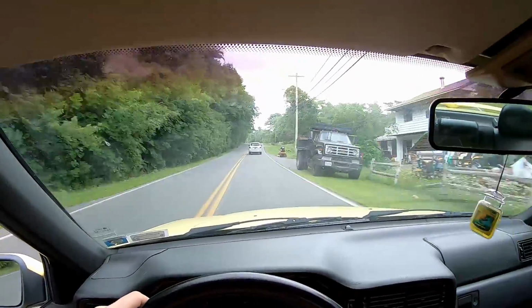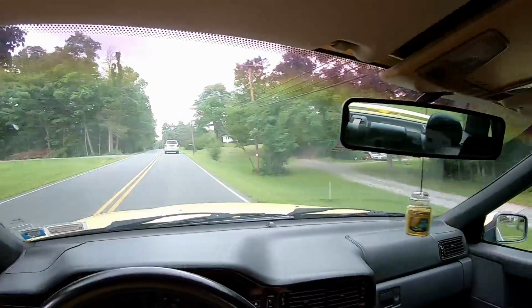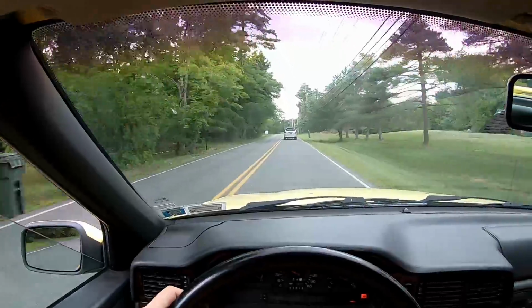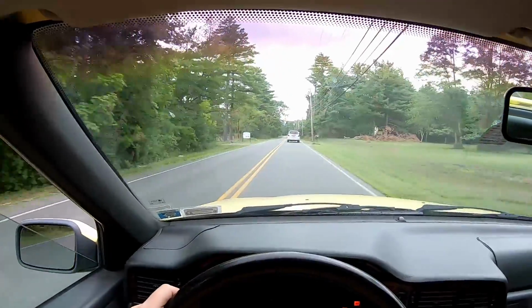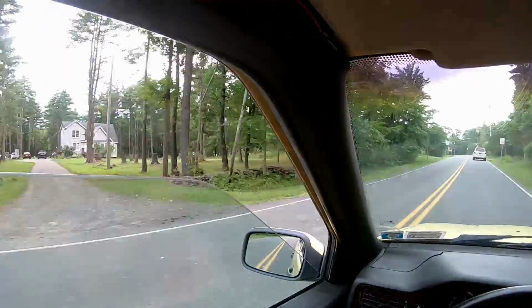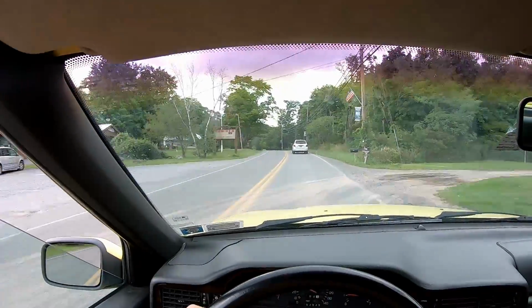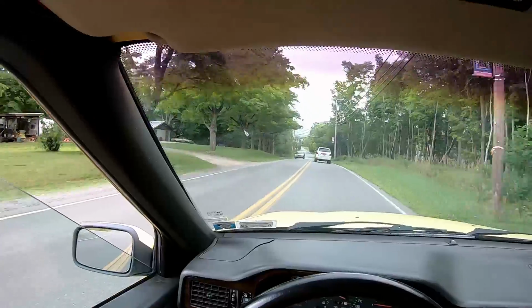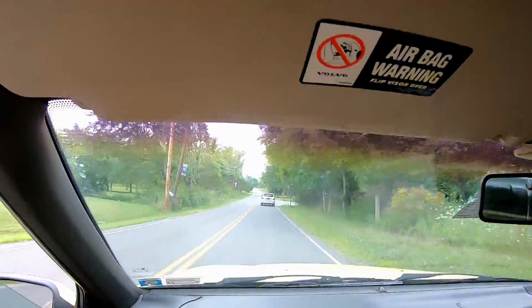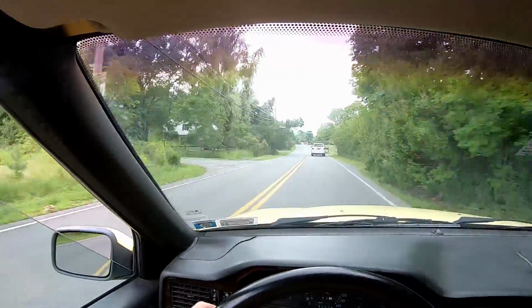Glad my speedometer still works. I had an S70 where the ABS module started going out, and so it knocked out my speedometer. So I just took my phone and sort of set it in here with a speedometer app. It worked out okay, I guess. So with that one, I just Dremeled it open and reflowed all the solder joints. And then it came to life again for the rest of the time that I owned the car.